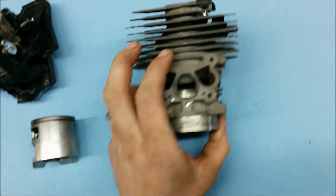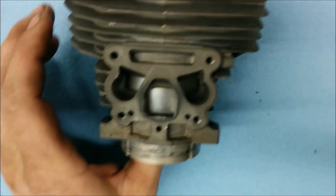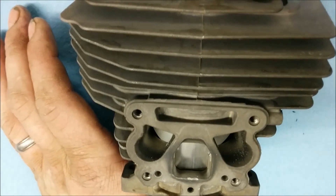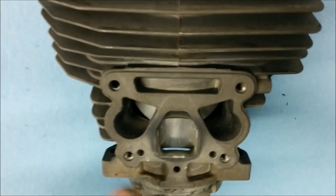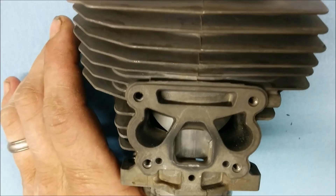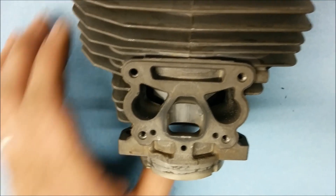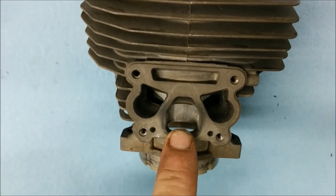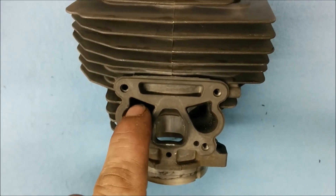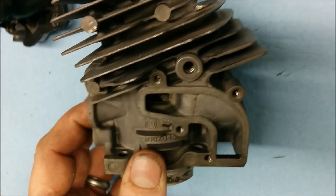You can see the piston right here — this is the intake side. As the intake opens, right about there, is when your transfers on the side begin to open as well. So you're starting to build a vacuum in the crankcase, so when that opens, you're starting to draw air and fuel in this port, which is the crankcase port, the carburetor port. And you're also simultaneously drawing air through the side of the piston right here.